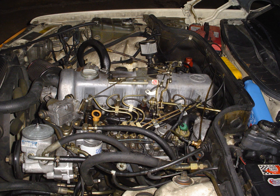September 1979 saw a new camshaft with greater valve lift, letting air and exhaust gases have less resistance. Power output rose to 88 PS. Torque remained at 172 Nm at 2,400 revolutions per minute. In November 1980, the MW-style injection pump was replaced with the M-type for non-North American engines. Engines were equipped with series-wired loop-type glow plugs up until 1980, when replaced by the much more reliable pencil-type plugs, which had already been used in the OM617A since 1978.